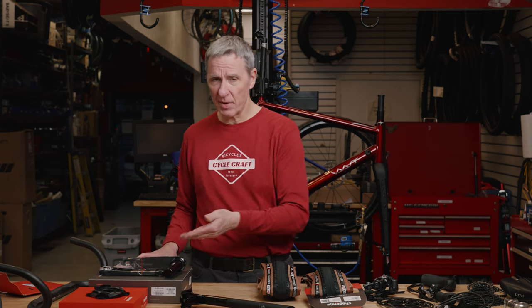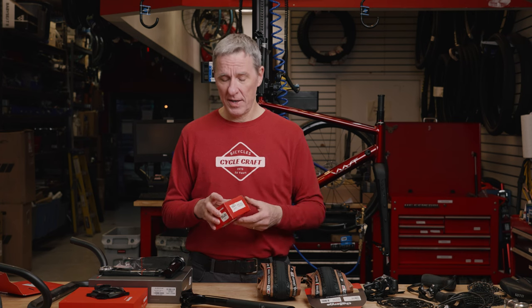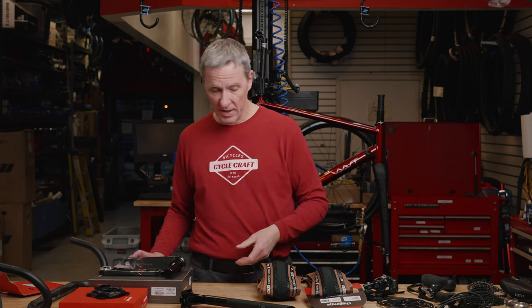Naturally, if you're going to be using a different bottom bracket standard or a different spindle, you have to have the appropriate bottom bracket that goes with it. Now, on my old bike, the Force crankset that I had was a GXP standard spindle. So I had to get a T47 bottom bracket that accommodated the DUB spindle. So new bottom bracket as well. So that's a fair amount of new parts.